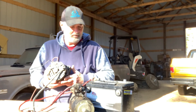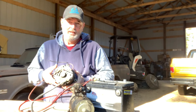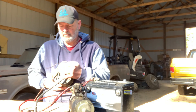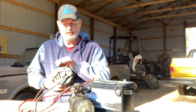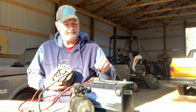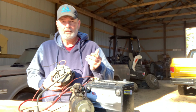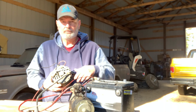I hope what I just told you made sense. I hope you can understand and get something out of this. I took pictures and drew pictures so we'll make it a little more simplified. Power to the battery. Number two goes to the battery. Number one is your key-on power. Auxiliary ground anywhere on the frame. Battery output to your positive on your battery. Questions, comments, complaints, recipes, favorite songs - leave them below. Thanks folks, talk to you later.